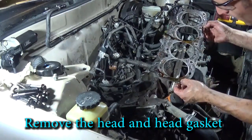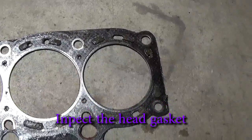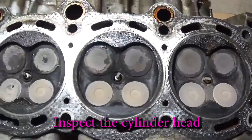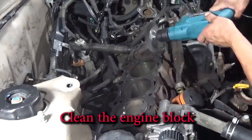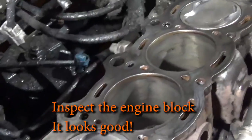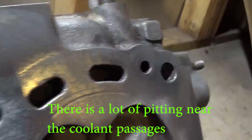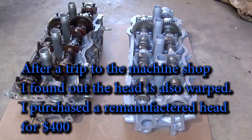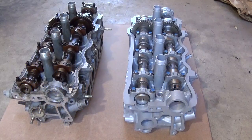Let's check out the engine block — it's kind of dirty and might need to be cleaned up. The head gasket definitely looks old and the cylinder head also looks old with a lot of carbon on the valves. I'm going to clean the engine block with a wire wheel — this is okay because it's cast iron. The head does not look quite so good; there's a lot of pitting where the water went through, so I should take this to a machine shop. I took measurements at the machine shop and found out that the head is warped, so it can't be used. I ordered a new one.